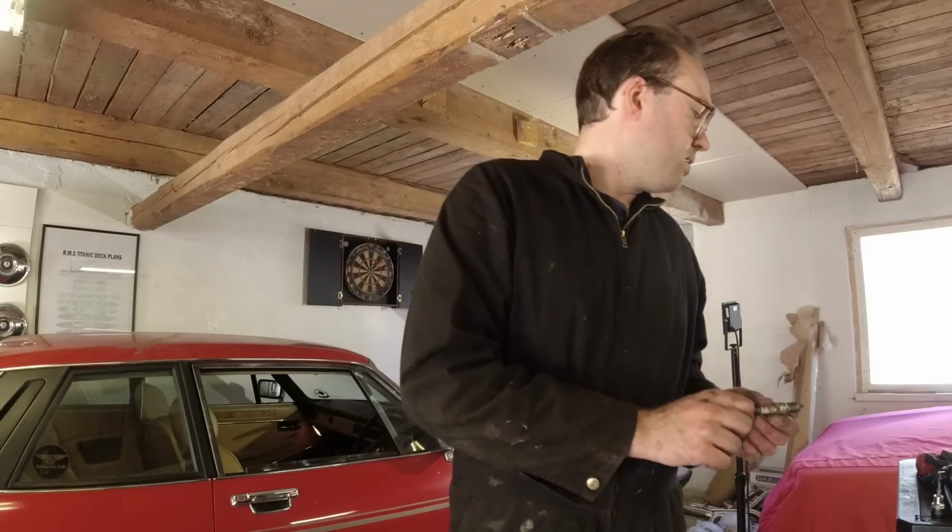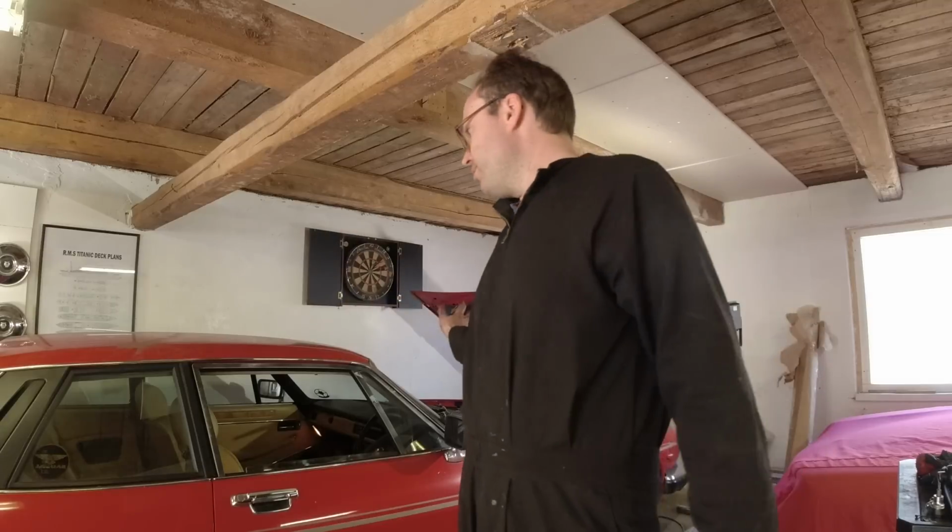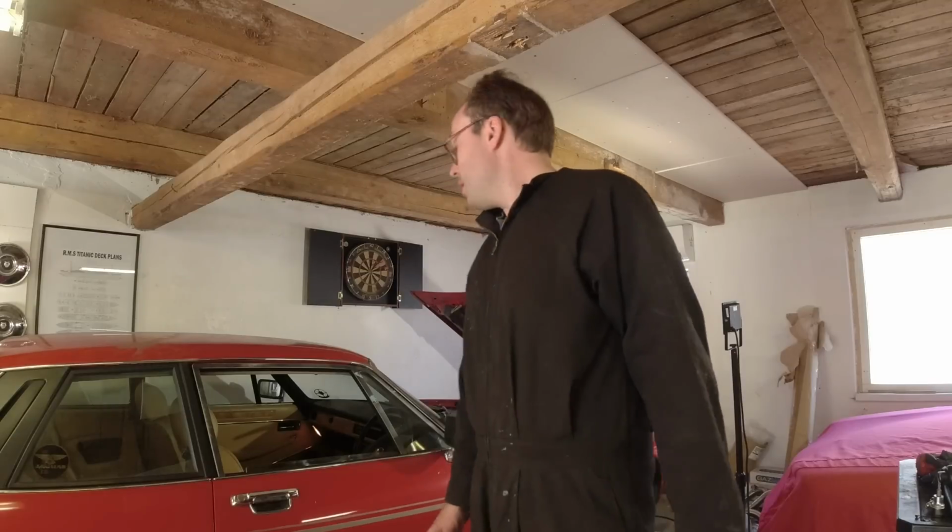So just be careful. These are aluminum engines. They're old. This one's 39 years old. So, you know, if a spark plug doesn't go in all the way finger tight, take it out, go to your parts store, buy a tap, just clean out the threads. You'll thank yourself. But now, let's see if this thing fires up.